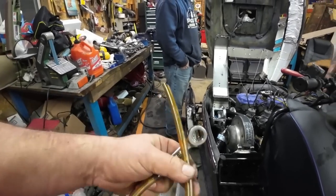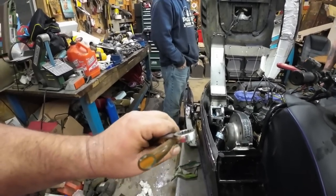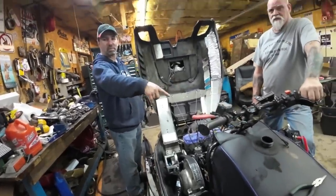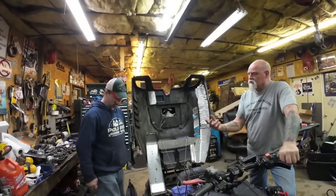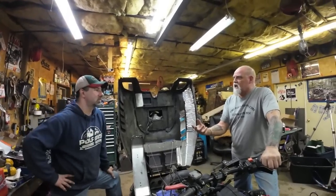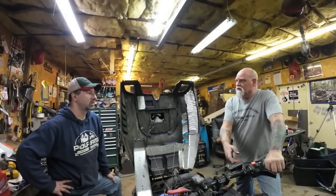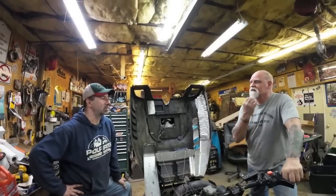Here's what we found. There's no weight on the end of Dennis's pickup. We think the hose is floating up. I bet it's floating around in there. Good luck, that'll be hard to find. Like the last ride, the first half of the day you had a full tank. Yeah, so it was fine, until that hose floated up to the top and sucked a little air. Yep, air. All right, I've got to find or make some kind of weight for this pickup.